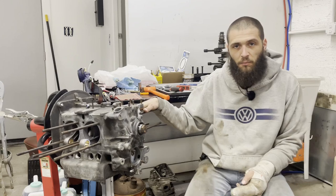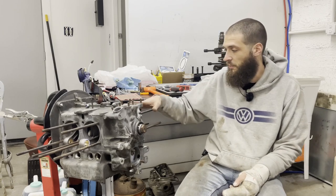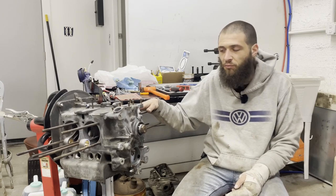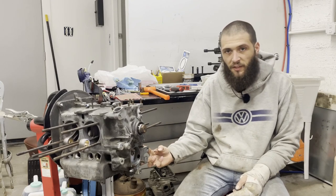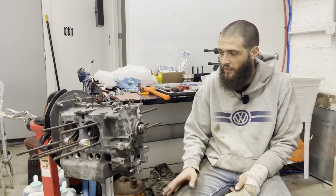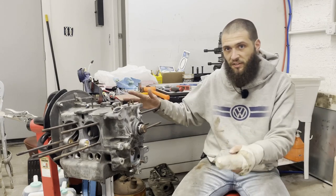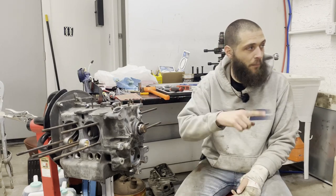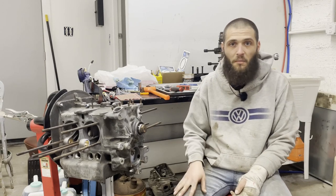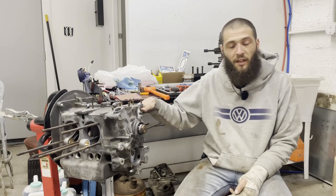Something that I didn't mention earlier in this video or the previous video: everything I've done up to this point and everything we're going to do pretty much out to the cylinder heads is more or less identical for type 1 and type 3 engines. Really the only difference here is that a type 3 has the dipstick tube that comes out of this and a different fan shroud and everything, but the long block is pretty much identical. I'll show you how to do everything else that is type 3 stuff after we get the long block together. I've got a type 1 that I have to do after this. I'm not going to show you how to do the case and everything on that because it is genuinely the same, but when I get beyond the long block, I'll show you how everything else goes together for that as well. But like I said, that's going to do it for this one.